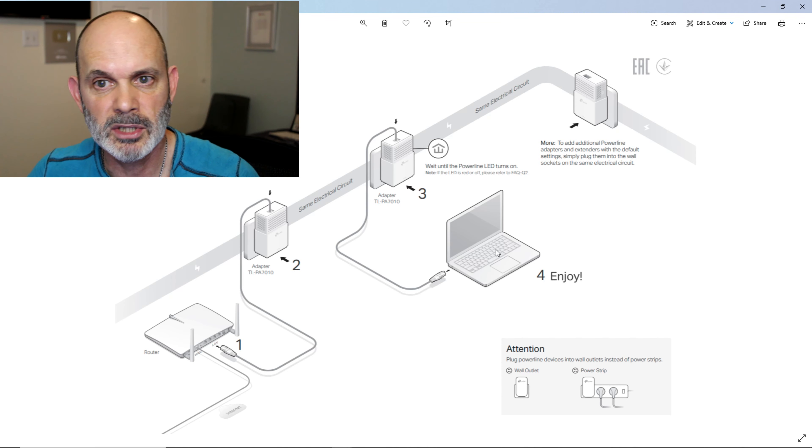Once you've got this all configured, working, and tested, you can do this in the same room — they don't have to be across the house from each other. Just connect them together and do the configuration. Make sure it works, because the worst thing to do is try to troubleshoot two connection issues at the same time, especially when both look the same. If your two routers aren't talking to each other, that's a problem you need to resolve with the LAN cable first before adding powerline adapters.